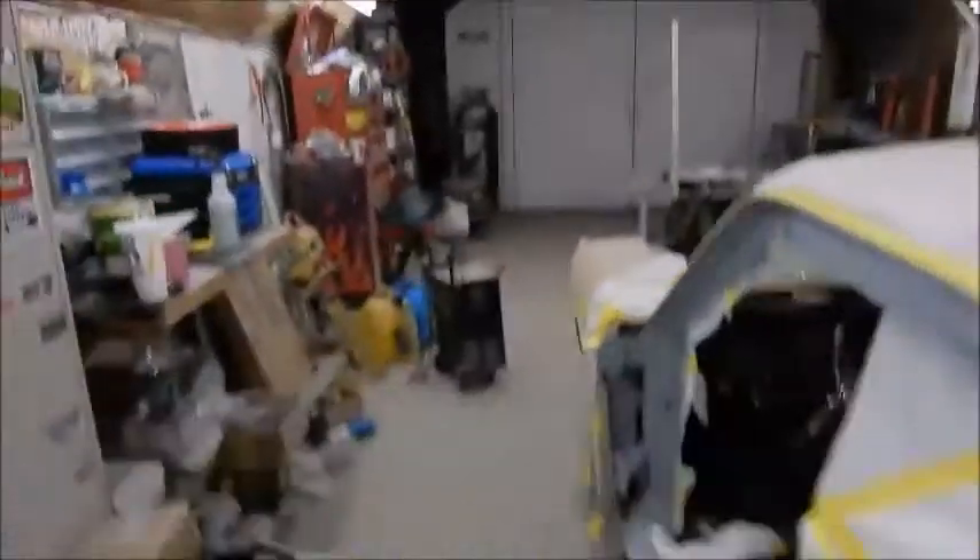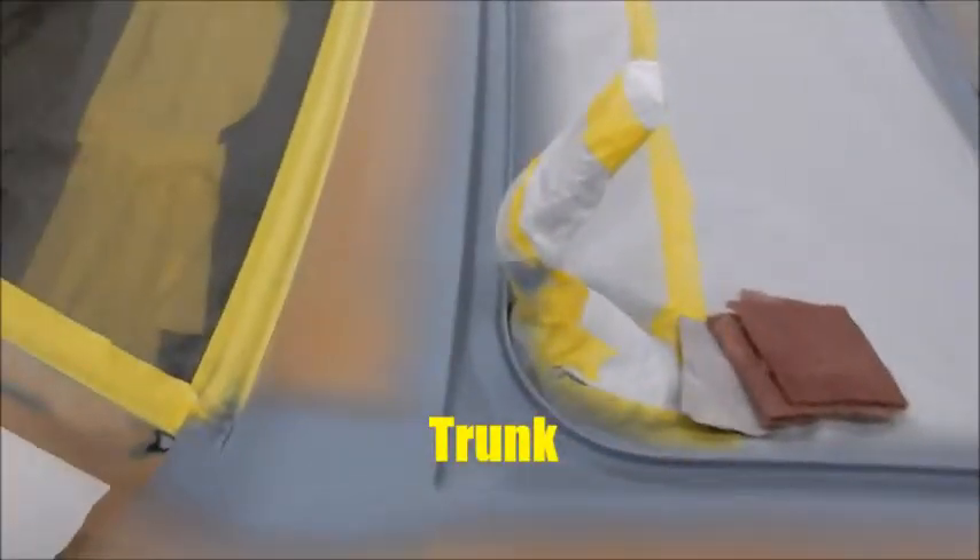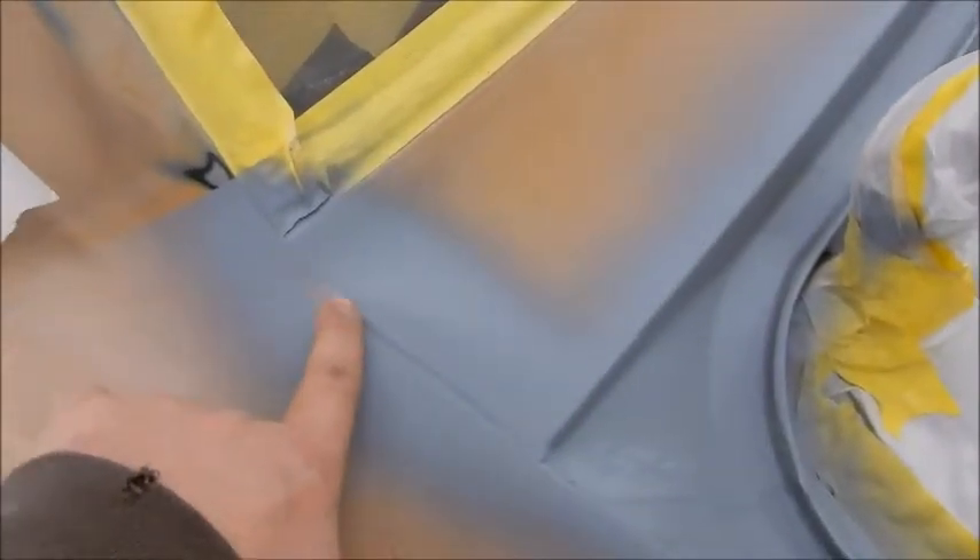It is nighttime here at Warren Customs and I don't have my handy-dandy stick to do my recordings. So we have the Mustang here behind me. The seam was a little bit deeper from the factory than what we wanted, so we went back and filled it in just a little bit. Pretty much just took filler, rubbed it out with our finger, and then blocked it down. I wouldn't advise trying to fill these completely up with filler because it'll just crack and come back out. We just kind of smoothed up the edge on that.